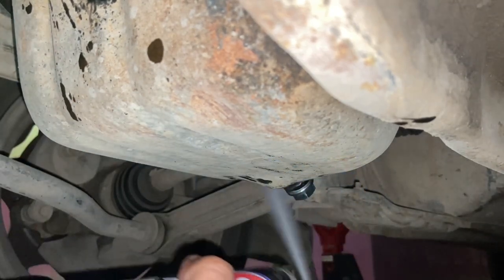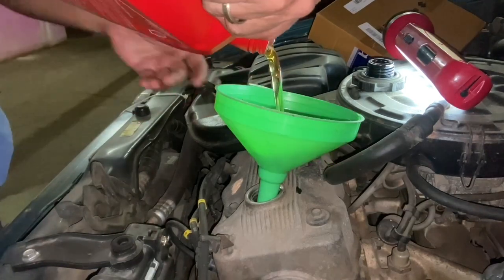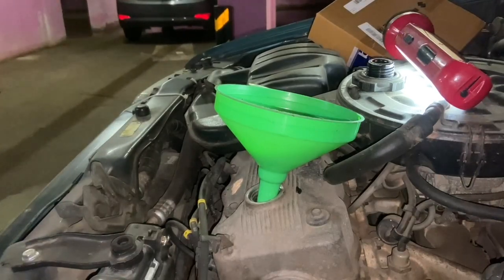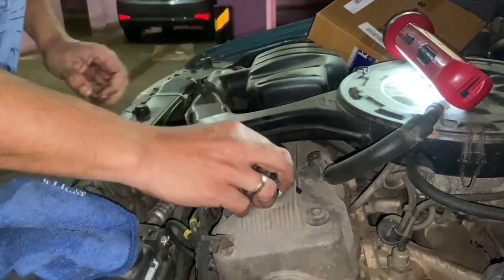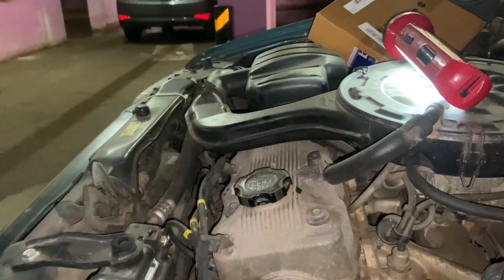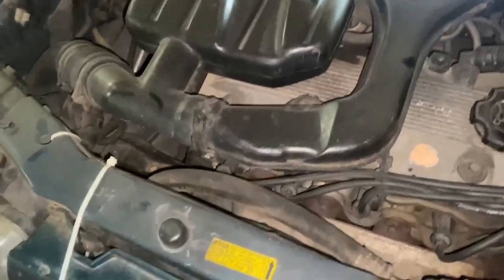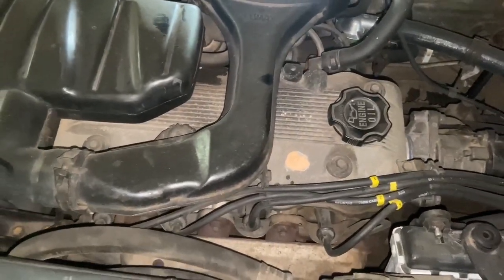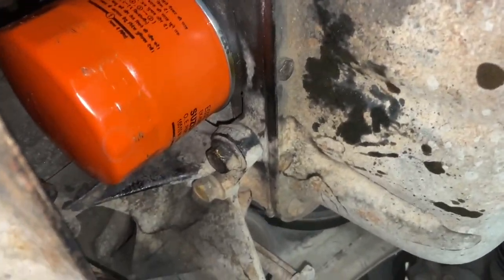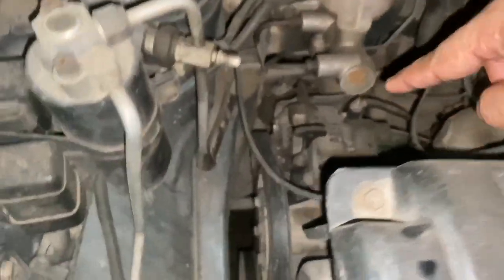Install the drain plug — as always, don't over-tighten this bolt as you do not want to strip the thread inside the sump. Clean the area with a cloth and a brake cleaner spray. The owner's manual states you need 3.3 liters of engine oil, so I've drained about 200ml from the can before pouring it completely. Clean the oil cap thoroughly and replace it back on top of the valve cover. Now that we've changed the engine oil and oil filter, we'll start the car and crank the engine to check for any leaks. There are no leaks at the oil filter area or near the drain plug area — we're good to go.